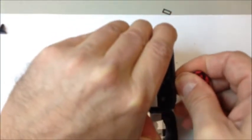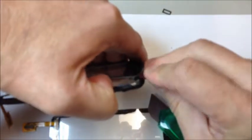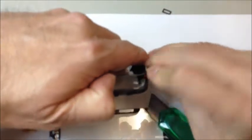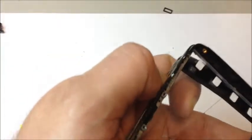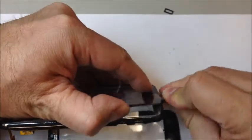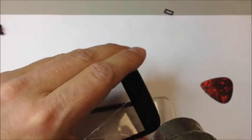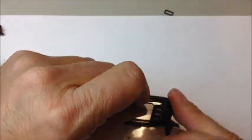I'm really taking my time here. I hadn't taken this phone apart before, and I've had trouble on a couple of Android phones by tearing the bottom flex cable — so I was probably more careful than I needed to be, but better safe than sorry. Finally this thing is giving way, and you can see the white squares are staying attached to the frame rather than sticking to the lens. That's exactly what we want. I've applied a little more heat to make this more pliable.